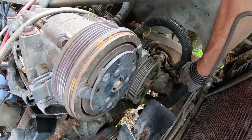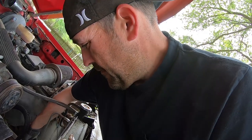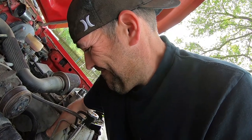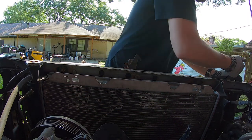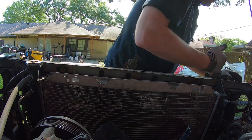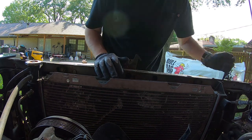Time for the spill. We need to remove the lower radiator hose and these two cooler lines going in there, and we'll be ready to basically unbolt and slide the radiator out. At this point we've undone that hose clamp - EPA, please don't pay attention. This is brand new Motorcraft coolant that I put in there about a year ago, so that's kind of a waste. We've undone that, we're just going to go ahead and pull that hose. These are 10 or 8mm bolts that we're going to go ahead and take out. As far as the radiator goes, you're basically just going to have two of them at the top - loosen those up, as long as all your hoses are disconnected, you're ready to slide this booger out.